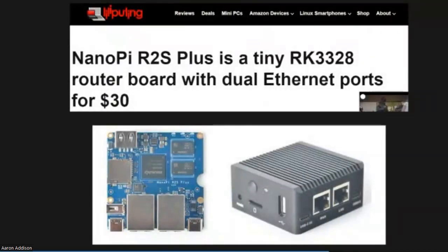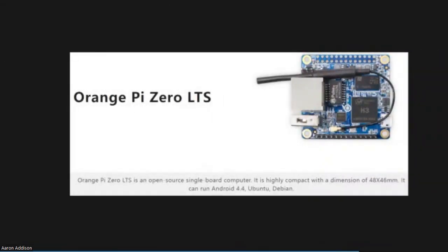Here's one that came out the other day — a tiny $30 computer that has USB and two network cards, which is not something Raspberry Pis have normally. So you can make your own firewall or router with a little tiny thing that consumes about 8 watts while it's sitting there. And then there's the Orange Pi Zero LTS. LTS stands for long-term support — they promised to make this model available for 15 years. It is less than 2 inches by 2 inches and can run Android if you wanted to. These kinds of things make great embedded displays for signage.